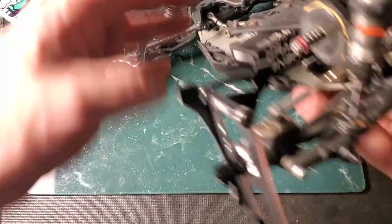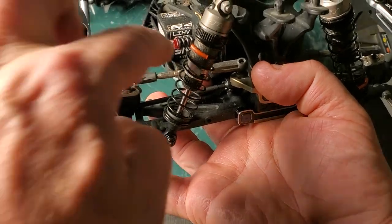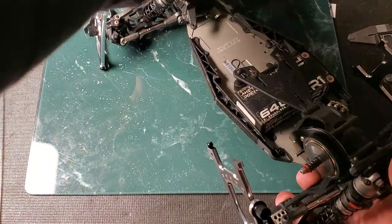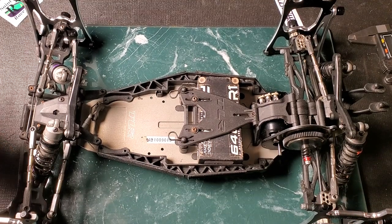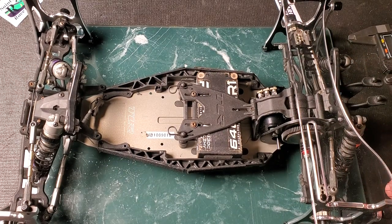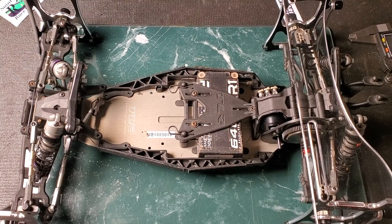Now, I'll just pick up the stand — you can see that when it's on the car, this sits flat and you would be able to tell what degree camber you have, then use a wrench to do your upper link adjustment and set your camber however you want. This particular kit also has the feature that the rear stands have a gauge there, so you're able to tell how much rear toe you have. In my case, I put it on and it looks like my car has about four degrees of rear toe per side — that's a very aggressive rear toe, and within a second I could figure that out.